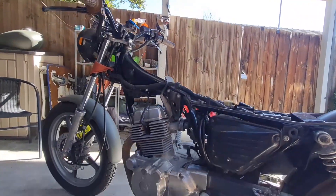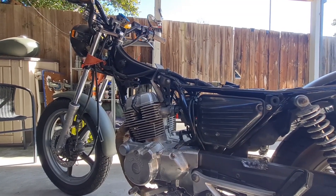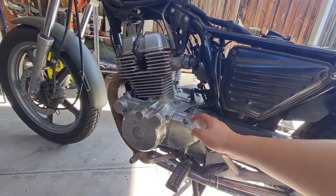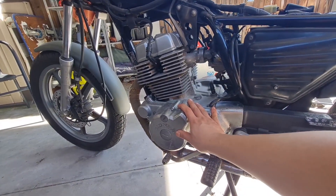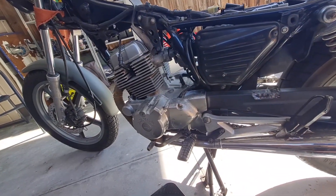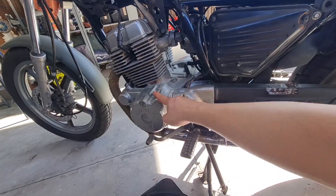I did a bit of research and the engine in this bike is the same engine that goes into the Honda Rebel 250s. It's a known issue for the neutral sensor to get dirty. On most bikes the neutral sensor is behind one cover, but in this engine it's actually behind this cover so it's submerged in oil - that's why it gets dirty. So what we're going to do is remove this engine side cover and have a look at that neutral sensor. Hopefully it's just dirty and I can clean it - if it needs replacing that's like 20 bucks. First I'm going to drain the oil, then remove these covers, and let's get to it.